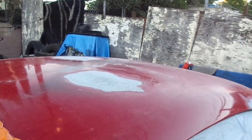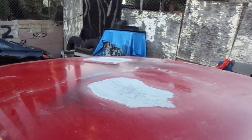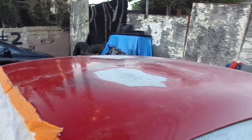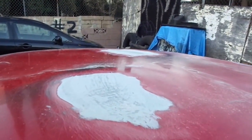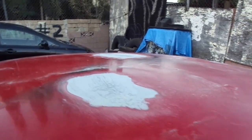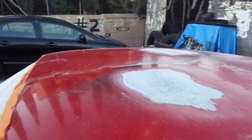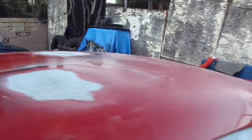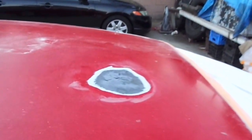For the last couple of weeks I've been working on it — I start from the top. I have two large spots on the top, almost at the front. I sanded down with 40-grit, very carefully, not to damage the bare metal. Then I realized there are some deep rusted spots and some veins of rusted spots, like this one, and this minor spot right here on the top.